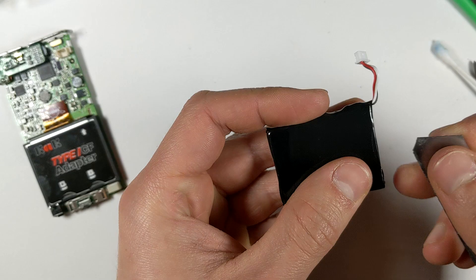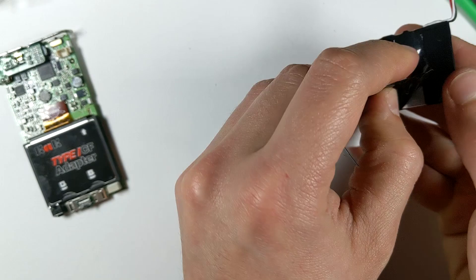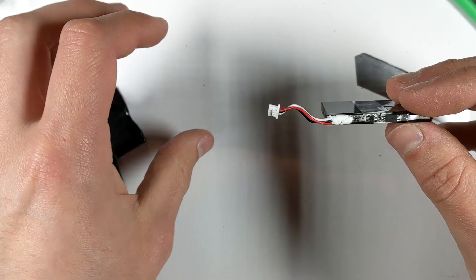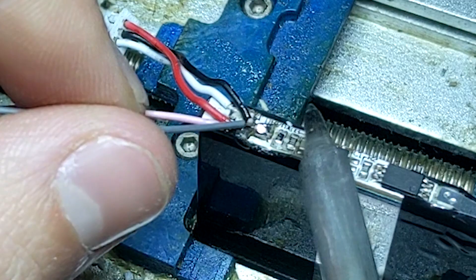After that's done we can move on to the battery. We need an extra positive and negative wire in order to power the Bluetooth board. I think the easiest way to go about this is to wire it off the battery BMS. First we need to take the protective plastic off of the outside layer of the battery. You need to be very careful when doing this as to not puncture the battery or disassemble the cell itself, as lithium ion batteries are dangerous and can explode if you do that. Mine had some liquid electric tape slash sealant over the connections which I had to remove first by scraping it off with the tweezers. Then solder a wire onto the positive and negative leads — the red wires are positive and the black wires are negative. You'll need to use thin wires for this mod otherwise there may not be enough space. The wire I used was from an old broken 30 pin cable.